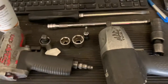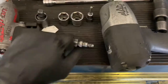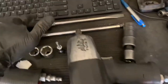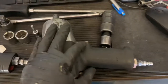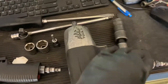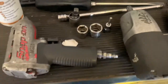For today's job we're going to need an 18 millimeter socket, 21 millimeter, and a number five allen to remove the speed sensor, a swivel and extension. You don't really need this long extension if you're not using an impact gun. A flathead just for some added leverage as a pry bar, or you can use a bigger pry bar, and the socket for the lug nuts that hold in the tire. This will vary depending on what you have. For the most part these are the tools you're going to need, obviously a ratchet with it or a breaker bar.